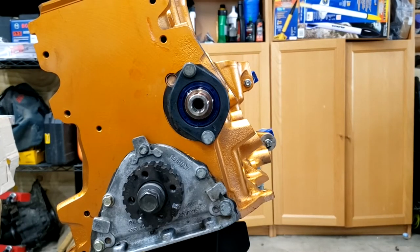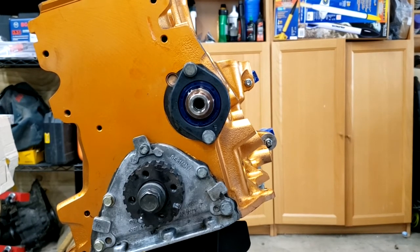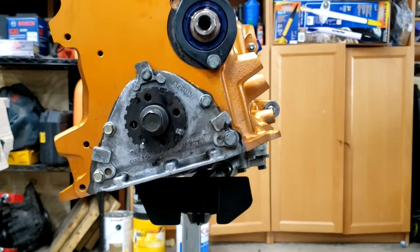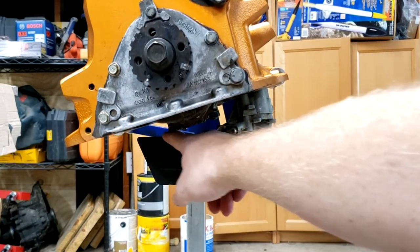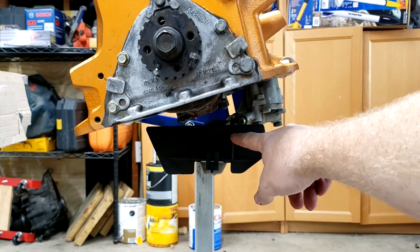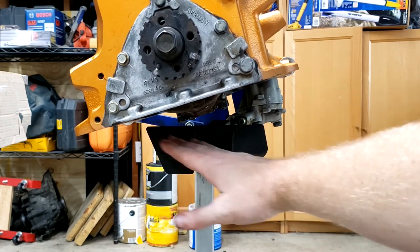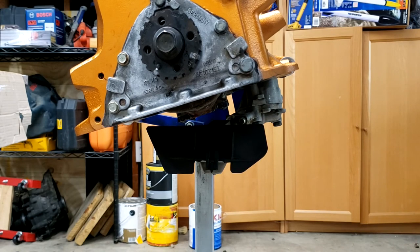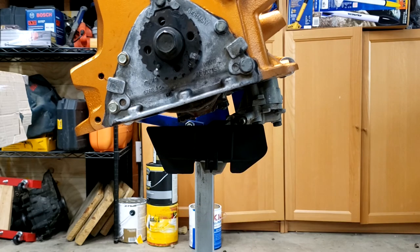One thing I want to point out is that our engine is going to sit at an angle in the car, and this comes into play particularly in the oil pan. So if we pan down, we can see the baffle for the oil pan. Okay, so we see this is level, so this will be about the oil level in our oil pan. And you can see just how close that oil comes to the crankshaft, particularly in hard acceleration, oil sloshing up this way, getting wrapped around the crankshaft, and that's going to cost us horsepower. So we may end up fabricating a windage tray. So this would be a metal tray that comes in here and kind of blocks the oil from sloshing up into the crankshaft. That's something, it's really dependent on whether or not we can get another bottle of gas for the welder. And Russ is looking into that.